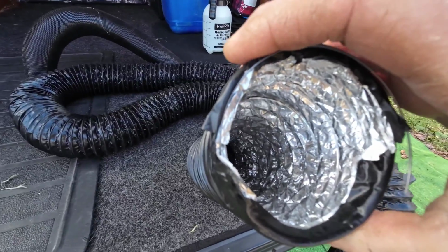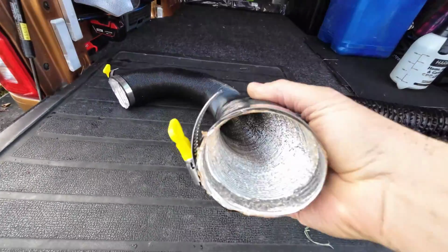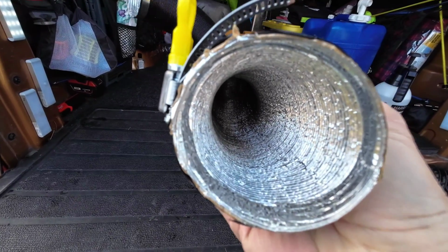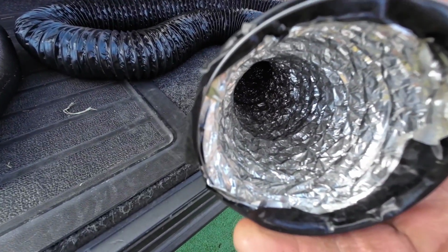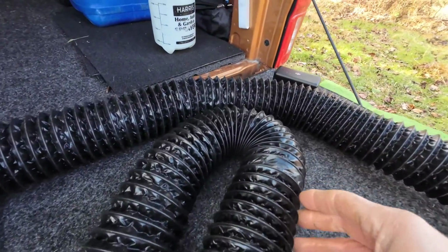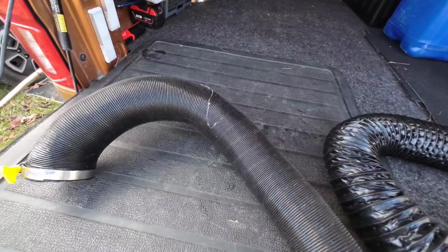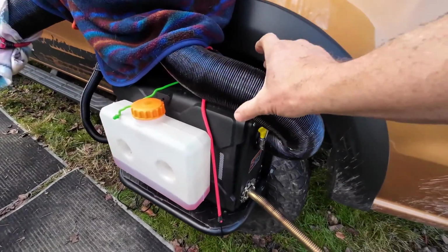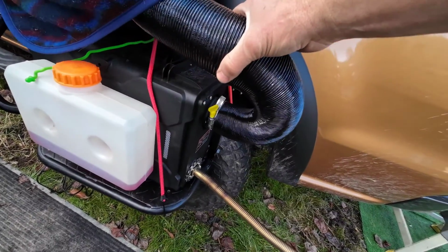See how you have all your ribs? Let's just think about airflow. You don't need an engineering degree to realize that this traditional heater pipe is nice and smooth, which means your air is going to travel through the pipe without resistance from all these waves or waffles, or whatever you want to call them. The other thing is that this pipe is more prone to tighter bends; it won't really take that shape. Over here on this unit, we could probably do a little better without such a tight bend, and that would also help with our airflow going out.